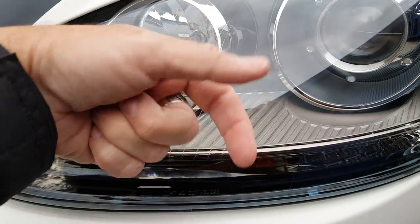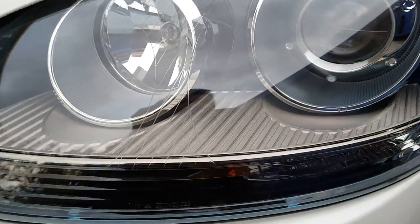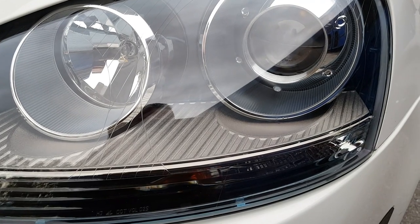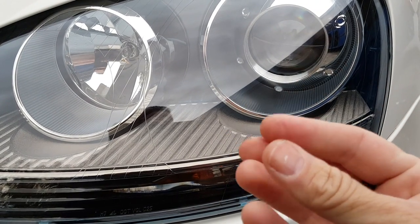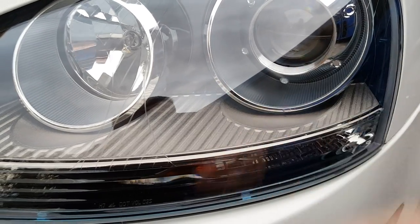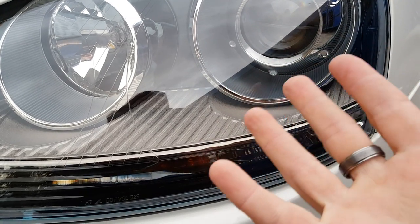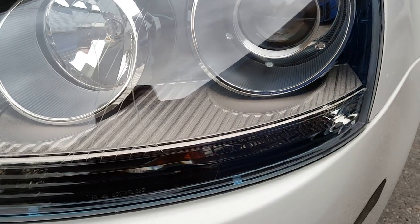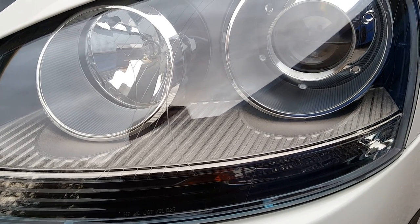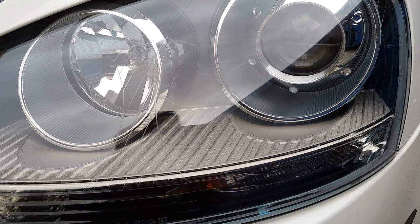When I opened up the back and took off the little cap, all the wires inside looked like something from a pharaoh's tomb. I touched the plastic just to unplug the igniter — the little red box — and it all crumbled. All the insulation came apart in my hands. I'd never seen that before. Usually they just look rubbery. Each bulb I tried didn't work — next one, next one, none of them worked.